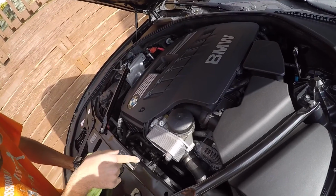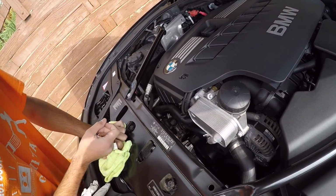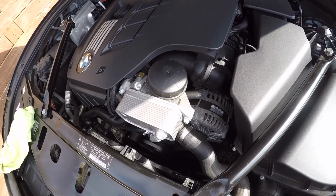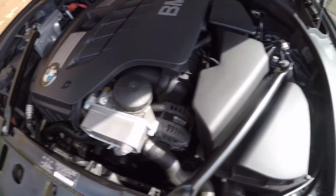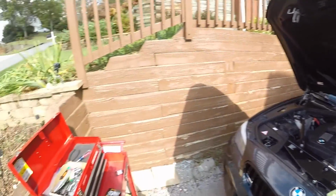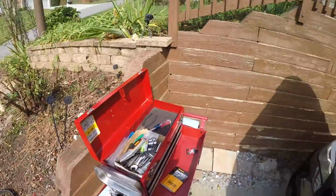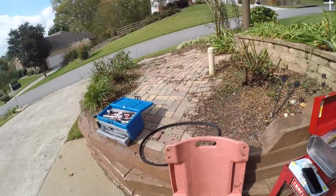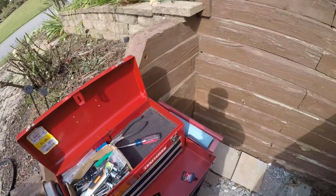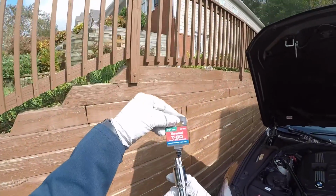Another important thing is to make sure that the tensioner is not vibrating. Okay. Pretty smooth. That's how you know the tensioner is bad? Yeah, ours is not moving at all. We need the T60. I couldn't find it easily. Luckily, AutoZone had it, and so I was able to run over and get one. It was like $6, so that's what I ended up buying.